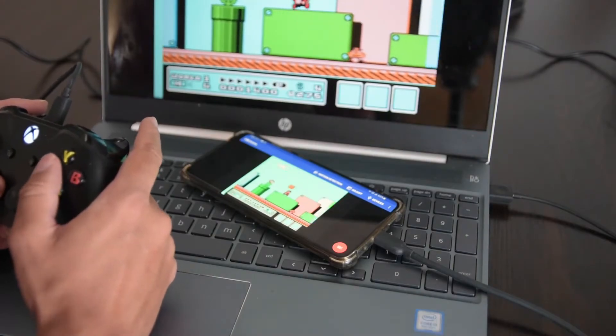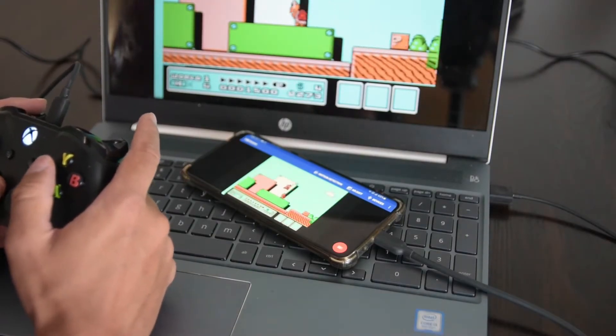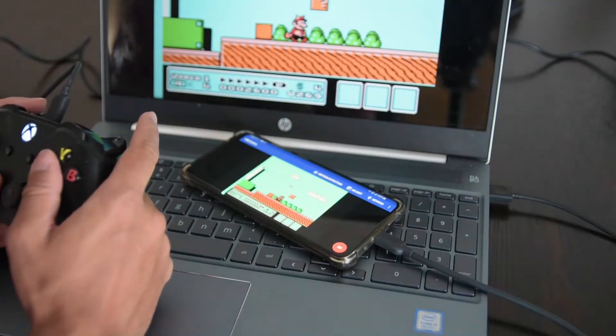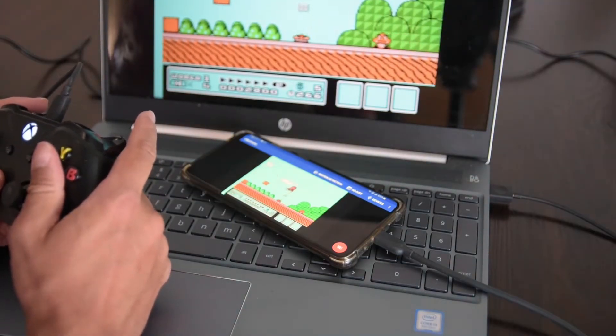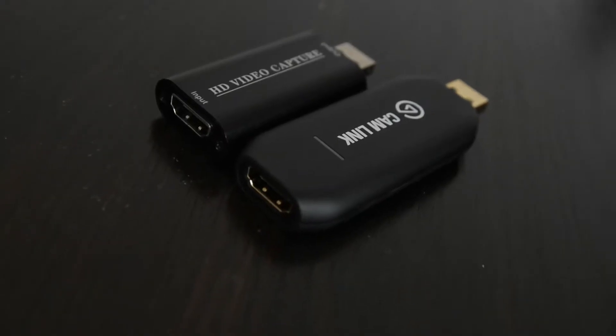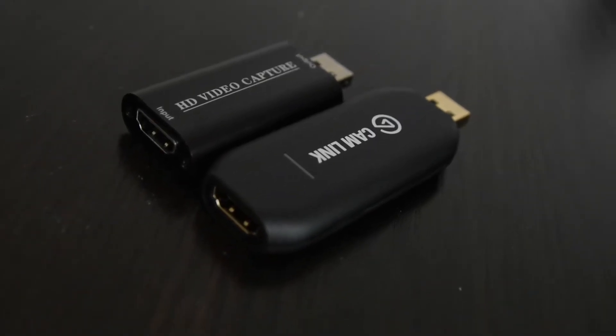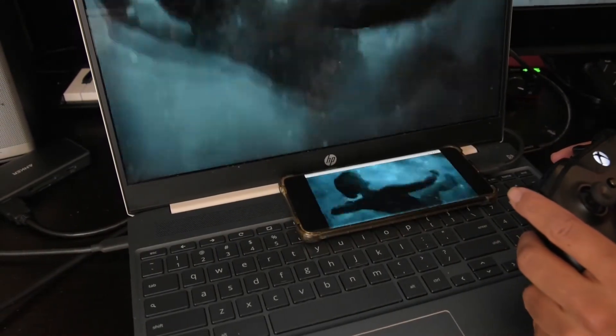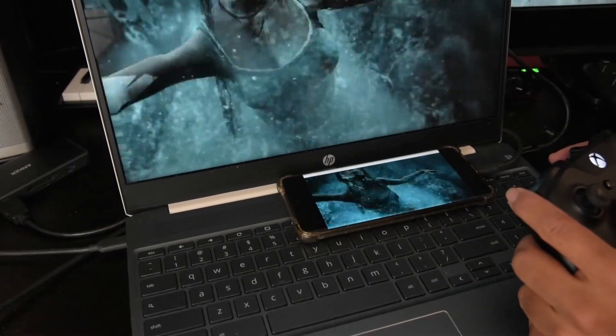I'm very impressed with how the captured video is closely synced with the source. But while actually playing a retro game, it does feel sluggish — I can definitely notice a delay between pressing a button and the action appearing on my phone screen. The downside to these dongles is that they do not offer HDMI pass-through, so if you plan on playing games with one of these adapters, you should get an HDMI splitter to avoid any lag they introduce.